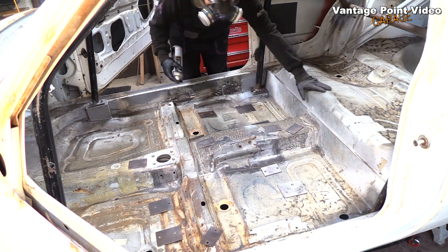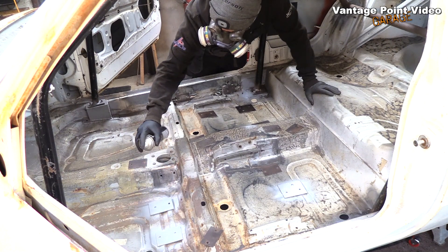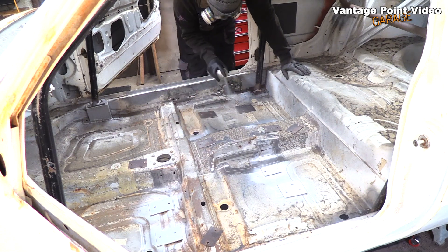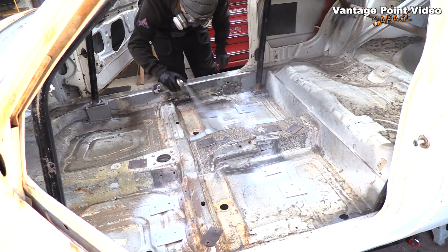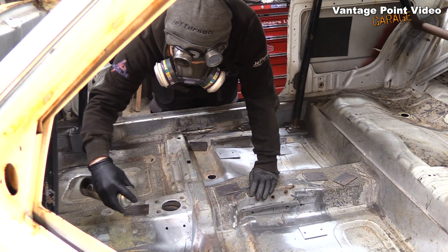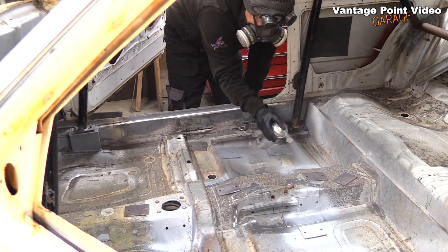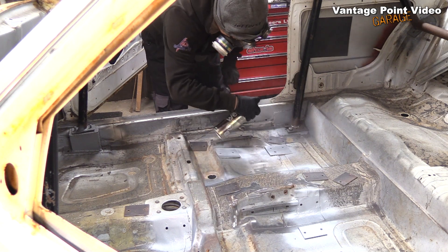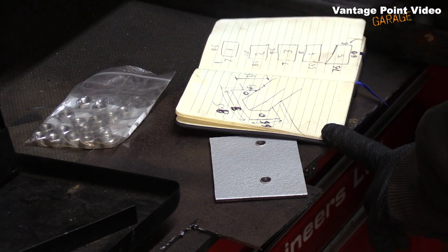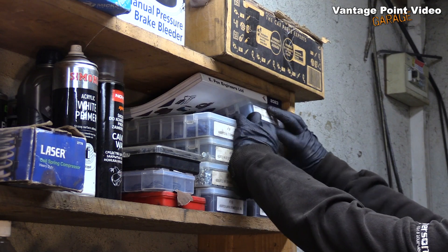This was the end of a day in the garage, so I decided I'd put some weld-through primer on the faces of the plate that will be towards the inner sill and the tunnel, just so corrosion doesn't build up there. I'll be welding on the captive nuts next. That's a bit of paint now for the inner sill and the tunnel sections, the contact points. I'll have to drill larger holes in this to accommodate the size of the nut and the weld around it. So that's plates 6, 7 and 8, and 1 to 5 - those are all the different plates and dimensions, the counter plates. I'm finished with my 3mm plate - there's actually more of it left than I thought, after doing the roll cage and all its various brackets.